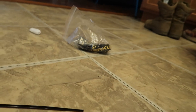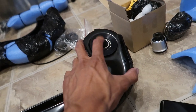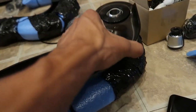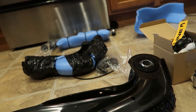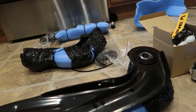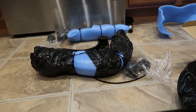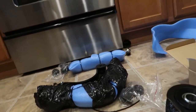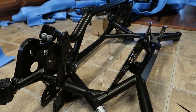We also got a lanyard. I should have waited to order control arms because their new ones are coming. This is more like an OEM-style control arm with just their bushing pressed in — it's a spherical bushing, no rubber involved at all. And that's half the reason to do this — to get rid of all the bushings, because during cornering a regular bushing is going to smush and throw your alignment off. Going to a style like this is going to be a little noisier and take more maintenance.